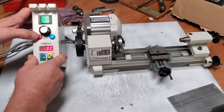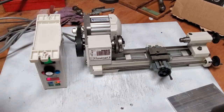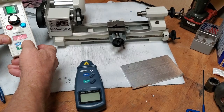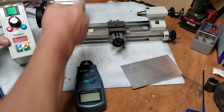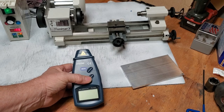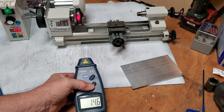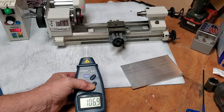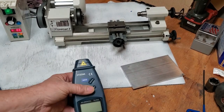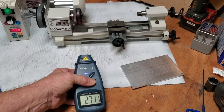You're ready to go — reverse, forward. I'm going to set P1 to 100 RPMs on the motor and power it up at the slowest speed: 107 RPMs on the spindle. At the highest speed: 2700 RPMs on the spindle.